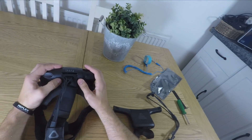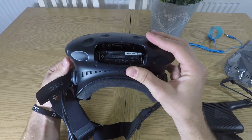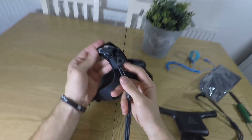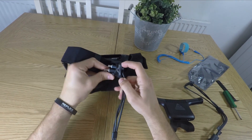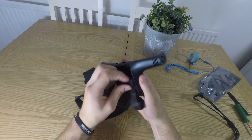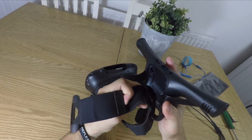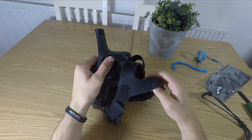The system recommends you don't have both the old link box and the new setup plugged in simultaneously, as it confuses it. You don't need anything plugged into your graphics card, which is excellent. For the headset installation process: remove the front cover by pushing forward on it at the top of the Vive, then slip those cables out. Push your thumbs downward then forward — there are a couple of hooks underneath that keep it in place. Once you've done that, tease the cables out. There's a small hook where you remove the wires on the head strap — that's where the hook on the adapter goes, then wrap the velcro around to secure it.